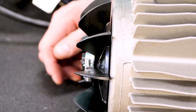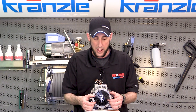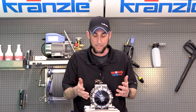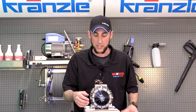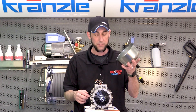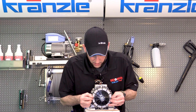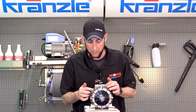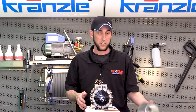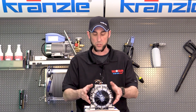If you can take and pry out on the motor shaft to get it to shift, or loosen up the fan to get it to shift back, you may be able to get some movement in the motor to get it running like normal again. Unfortunately, that may not always be the case — we're more confident we can fix a dented cover, but if the shaft is shifted and it's rubbing on either the motor frame or the fan cover, you have to fix that before you can even give it a try. Once you've got it adjusted, there should only be a little gap between the fan and the motor frame. Put your cover back on, and I would probably test it before putting all the hardware back together, just in case you have to readjust one more time.